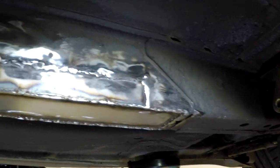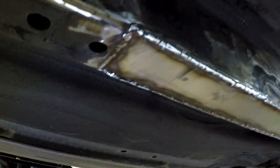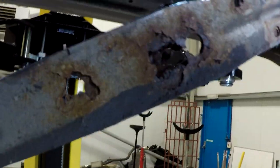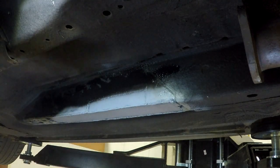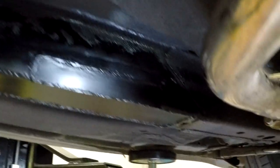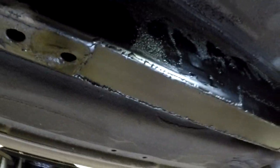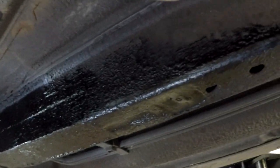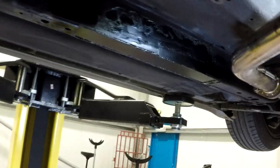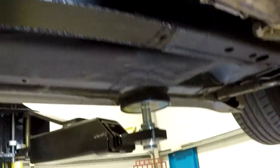The welding was pretty bad - I hate MIG welding now that I've done some TIG welding. MIG welding seems so messy and horrible, partly just because I'm bad at it. It didn't line up very flush with the existing bits so it's kind of sunken in, but it's better than what was there before. Once it's painted and covered in underseal it won't look that bad. Now that it's painted it's looking a little bit better - I'll stick some underseal on and it should blend in. It looks out of place at the moment because it's all new and shiny, but once it gets a bit of road dirt on there it'll blend in fairly well. Hopefully that'll be a lot better than rusty.